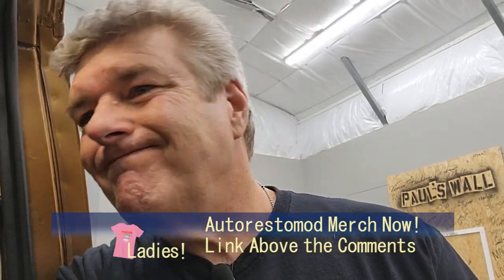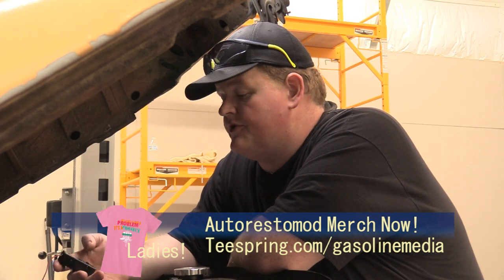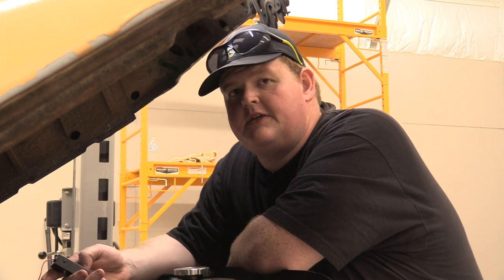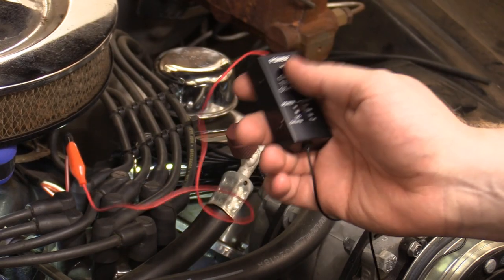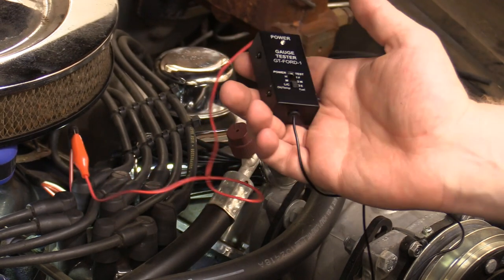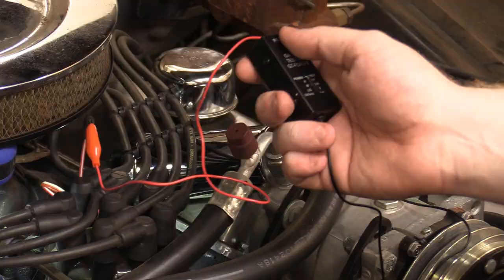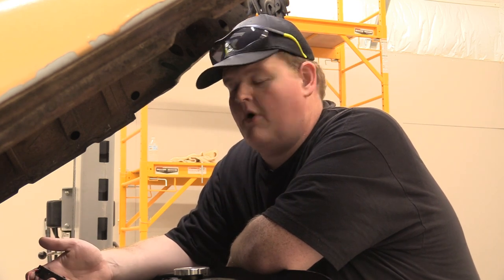It's dropping. This tool will do oil pressure, water temperature, fuel pressure — pretty much any of your standard NPT sensors. Any of the zero to 100 ohm range Ford sensors will be pretty applicable to this. So this lets you test everything on the electrical side of the gauges. If it still doesn't work, as I said earlier, your sender is the issue. Accuracy of your senders is another thing to test, and that's a whole other snowball of stories to deal with.